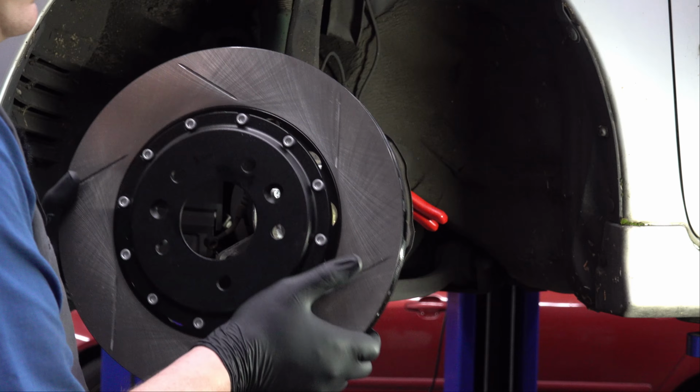In case you've never heard of that, that's what these pinch pliers are for. I use them to pinch hoses. Don't use it on any sort of plastic hose, but on a brake hose it's okay. So I'll just get in the way and put it up there, so I can crack this bolt loose on the back. Turn that a little bit.